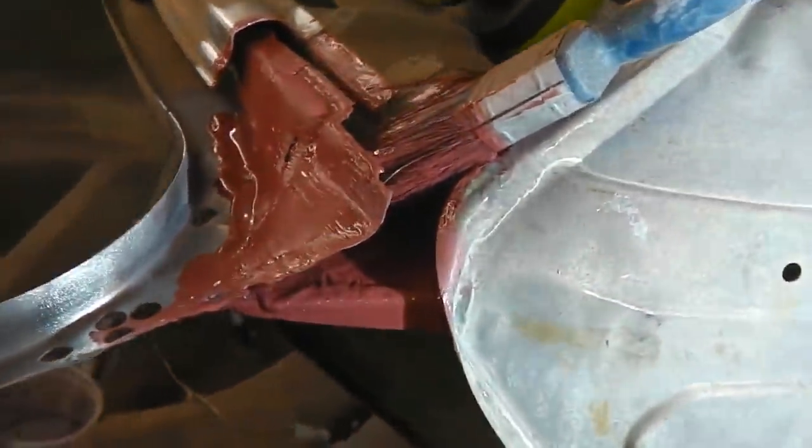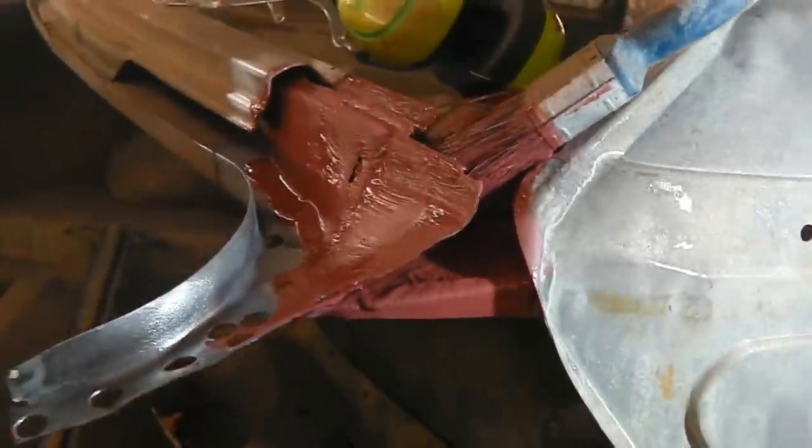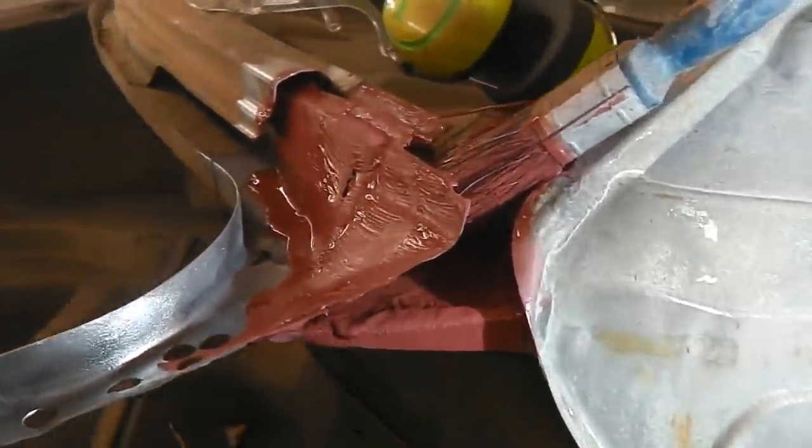Okay, with the metal nicely cleaned up, we're ready now for the weld through primer on it. We might as well just cover the whole area. This is going to get extensively treated inside these box sections, and you can still get to the end of them even when this repair goes on. We need to do that before the outer quarter wing fits.